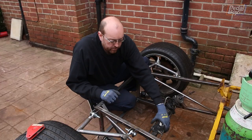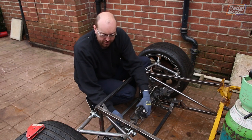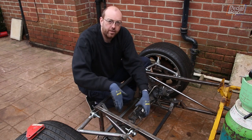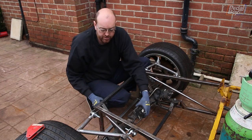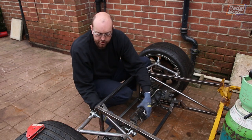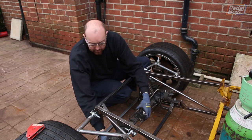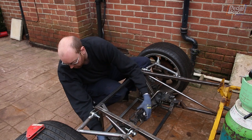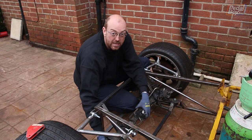We've got our frame tacked in now, so we can start looking at the brackets to actually mount this onto the side of our frame. We've got this raked back at about 55 degrees in the end, so it gives us a decent angle on the steering column into the passenger cell. The brackets themselves will just sit on the inside edge here. The arms want to sit parallel, so we need to have this approximately this high up — we will actually probably measure it, but for the time being it's good enough.